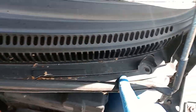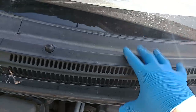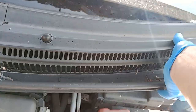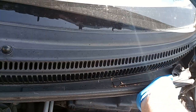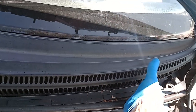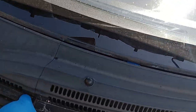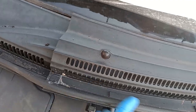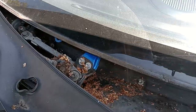On this car they seem to be missing. Once you've removed them, it's the case of removing this side first — you literally just pull it up with the weather strip still attached to it, and you pull it towards you and away from the windscreen. Same with the other side.